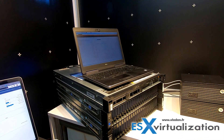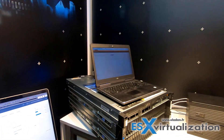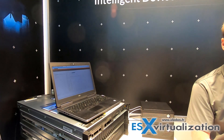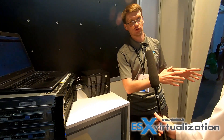These are microservers on a card built to the same standards that enable ESXi or another general-purpose OS and hypervisor to run on ARM systems. There's a higher standard called the Server Base System Architecture, and a firmware standard called the Server Base Boot Requirements. These specs basically make ARM infrastructure look like x86 infrastructure - using EFI and ACPI, and common-sense approaches to IOMMUs and PCI. At ARM TechCon, ARM said these are not just server standards but standards any footprint must adopt if you want to run general-purpose operating systems.